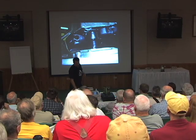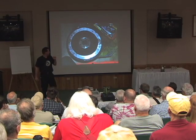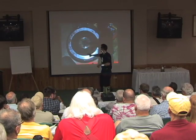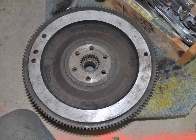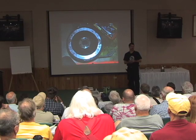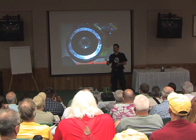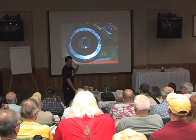Here's a close-up looking through there — that's actually from the original coupler. Now another way to do it: a friend of mine is working on an electric pickup truck conversion. This is the flywheel from his pickup truck, and in his case he's keeping the clutch so he's going to reuse the flywheel. If you look real close in the middle you can see splines that were actually cut into the flywheel. He found a machinist with a special tool that can cut splines into pretty much any type of metal. So this entire flywheel will just slide right onto the end of his electric motor, and it keeps the original clutch and everything.